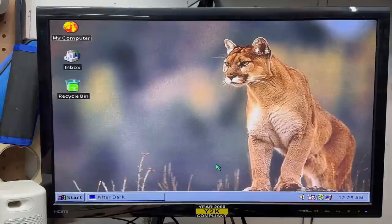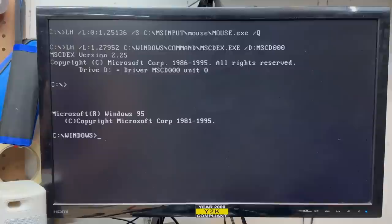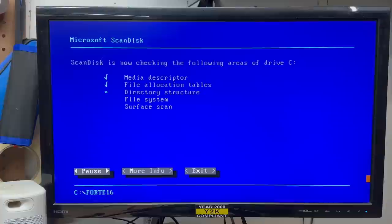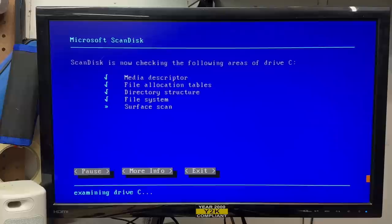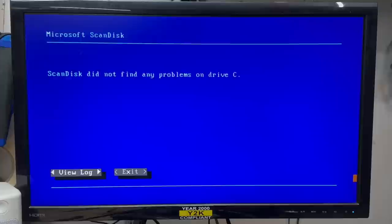Let's drop down to DOS mode and check out that hard drive. Skip undo. Not too much file system trouble - proceed to surface scan. I've never seen that interface be so noisy. I think we're going to win. Yep, healthy little hard drive. Now I've got to get DOS, bench, and a few games on here. My favorite way to do that is with good old zip disks.